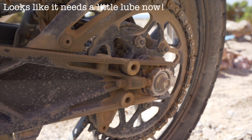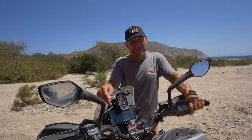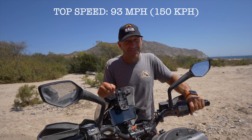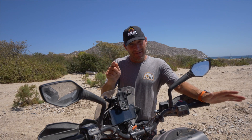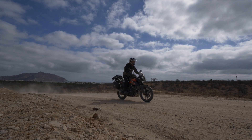In the first 2,000 miles I have not had any issues whatsoever. We did tighten the chain slightly at the 600-mile service. For a thumper, I get no vibration even on road. My top speed in Mexico has been maybe 70 miles an hour — this thing will go faster and certainly has the power, but with narrow roads and animals wandering around, that's as fast as I'd go. I'm finding about a 250-mile range on a full tank, mostly off-road — on pavement you'd probably get better.